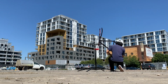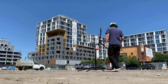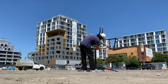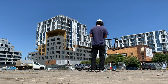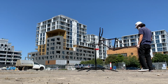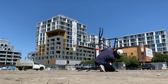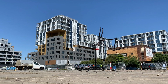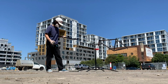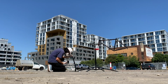The first thing I noticed when I was using the spray paint, as soon as it came out, it would dry a lot faster. Almost the paint would come out dry as opposed to wet when it hits the frame. So I think that's why they recommend holding the can a little bit closer to the frame for a smooth, even coat. So that's number one. The paint comes out dry, a little bit different, but it's going to give you less drips for sure.